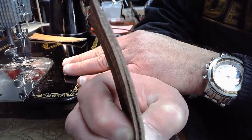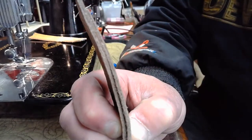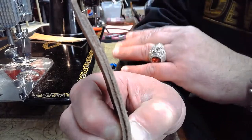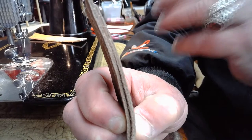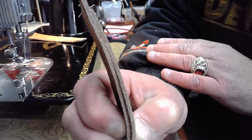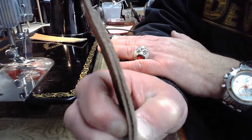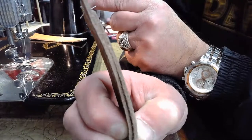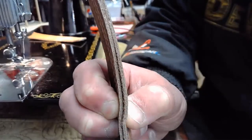So that it was delivering, even though it's only about 0.5 amps, you want to compare it in your mind. A featherweight comes with a 0.4 amp motor. But here's the thing about the featherweight. It's got that super long belt that goes down to that output pulley on the motor. And then it goes all the way up over that balance wheel. You lose a lot of energy when you have a belt strapped like that on the machine. Not so on the 1591. You've got that gear to gear. The power goes directly from the motor right to that main shaft, down to the needle bar, and then it hits leather like this, and it goes, what's the big deal?